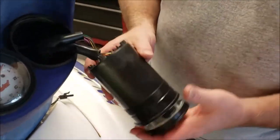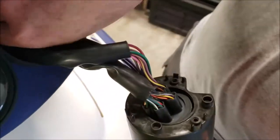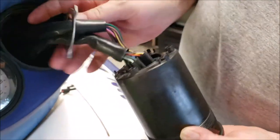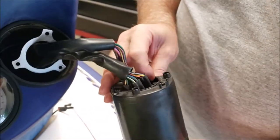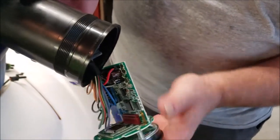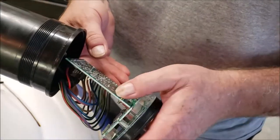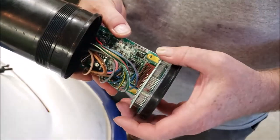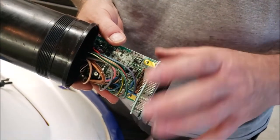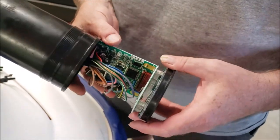To separate the gauge after you take the gasket off, there's a metal plate on here — take these three screws out that sit in here, then push the whole grommet into the gauge. You can reach your thumb in and push on the back of the circuit board to push the guts right out. Then take this screw and this screw out, and that will allow us to separate the display — the monitor face. We'll tear this apart and show you the last step to get at the film.